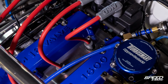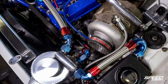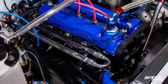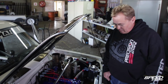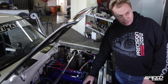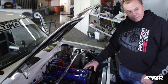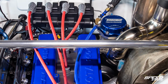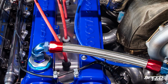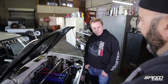7A sub-assembly, it's an 1800 Toyota with a 4AGE cylinder head. Then I made a custom intake manifold, bigger throttle body, front mount intercooler. I see you're running 2 rows of fuel injectors. Yeah. I always used to use one rail with one set of injectors, but I added another set so if we want to go higher on the boost, we activate the second set when the first set reaches 50% duty cycle, for better atomizing. On the cylinder head, I've gas flowed it. I went to different valve springs, bigger intake and exhaust valves, custom grind billet cams. It can rev 10,000 RPM, no problem.